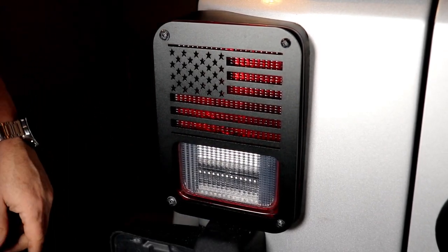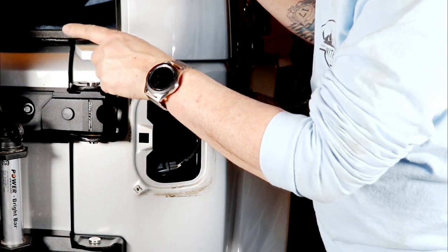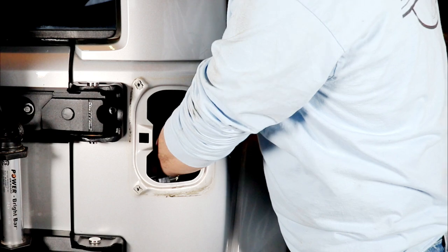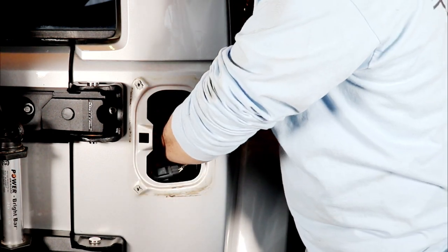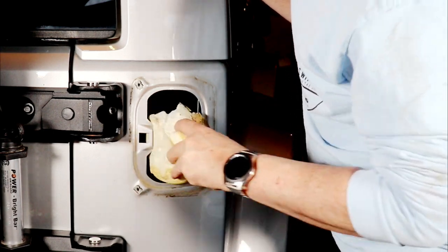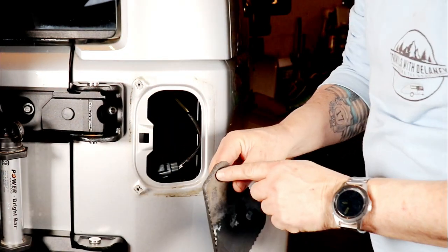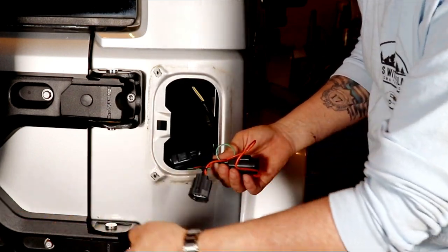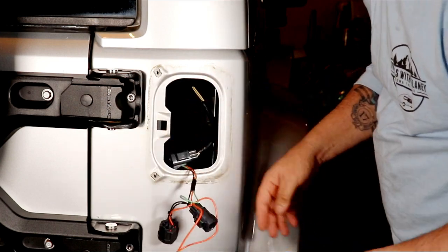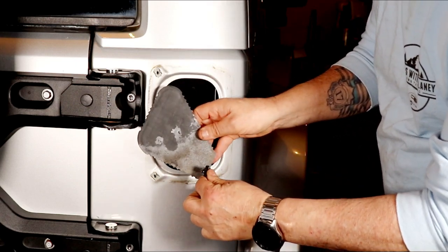Next, go underneath and run that orange, green, and brown wire over to the passenger-side taillight. Over on the passenger side, unlike the big hole on the driver's side, there's a big piece of foam in here that you're going to break off — it'll give you access to the plastic panel that's down there. I'm just going to notch this a little bit so we can run the wires up. I've run the passenger-side wires along the hitch along the bottom, wire-tied it, and brought it up into the chamber. The little plastic piece that covers the hole — I cut a small notch in it and will slip the wires through.